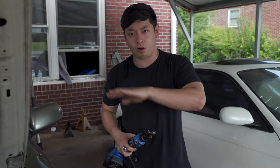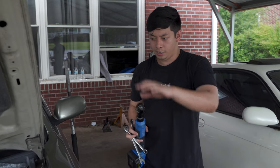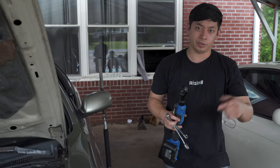Alright, so Si went ahead and got all the stuff on top done. Now we go under the car, take off the down pipe, disconnect the front from the exhaust, and up here the manifold, the bottom mount turbo, and the turbo elbow will come up from the bottom. I'll take the down pipe off and we'll continue from there.